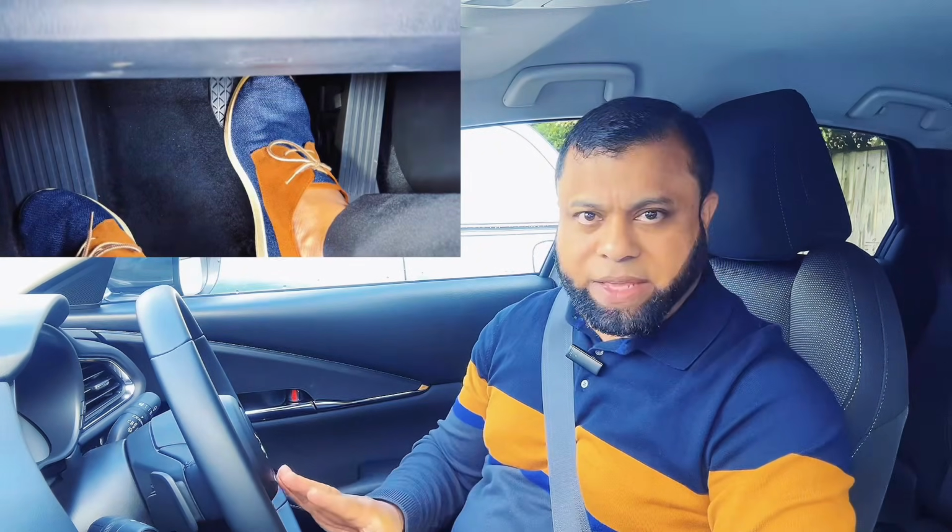Okay? Engine off and you go. So just one more time, just to remind you. You're on drive and you're driving and you stop. Put your foot on the brake, keep it on the brake, put the handbrake on, go to neutral, let the brake go. The weight now is on the handbrake. Put the brake on again, go to P, lift your brake and turn the engine off and go. That is the sequence. That is the best way for you to look after your car, the best way to look after that little pin so that it doesn't wear off.